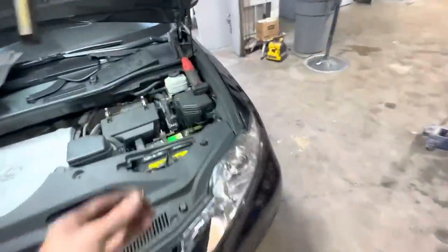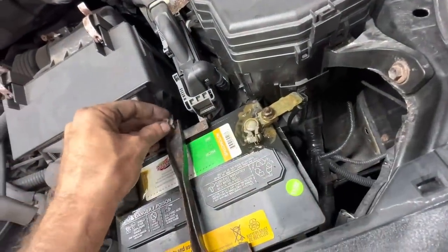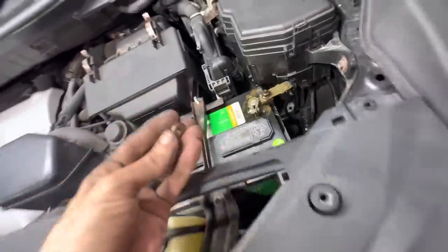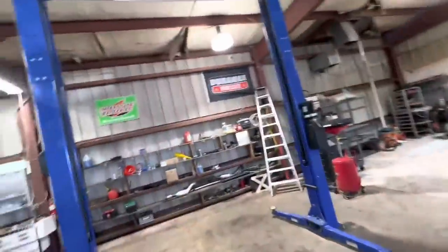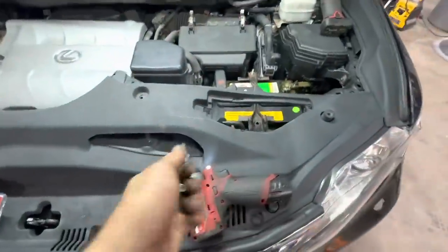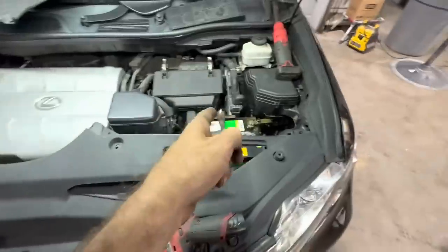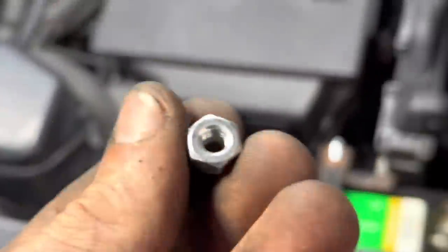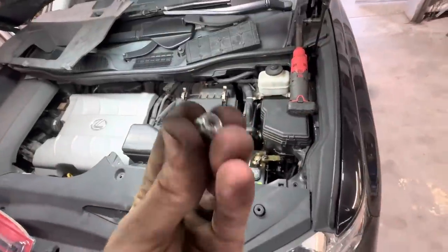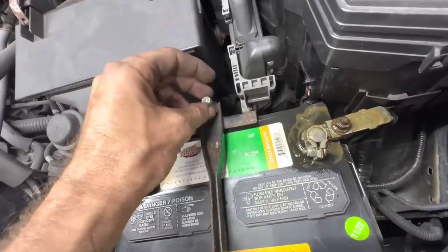It's just better. Tell me the threads are the same. Tell me the threads are the same. Oh, and they're not. Come on. Come on. Stupid. That's fine, it is of no matter. I found a nut. The problem is the original one was metric threads and these are standard threads, but I have a standard thread nylock nut. So I'll just use that.